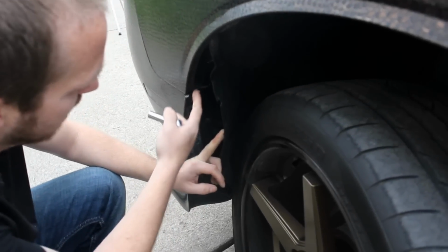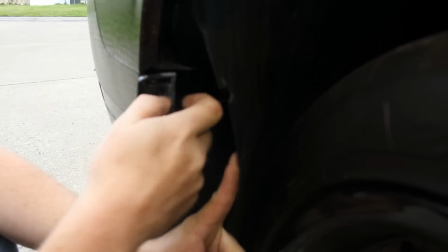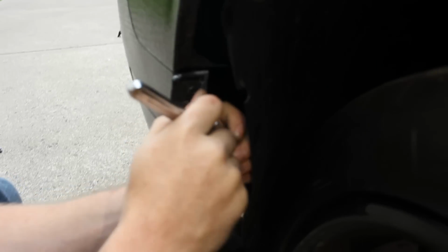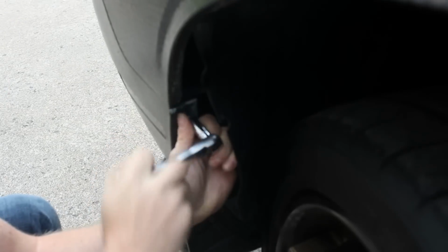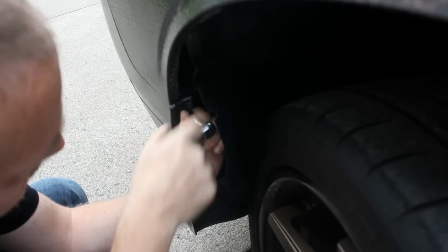Alright, so before we start on that back bolt, let's focus on these. Removing this bolt right here will allow you to pop the bumper cover right out and away from the body. And that little bolt all the way up there will help it release from the front end. So we're going to start with this one, and this is usually a really easy one. It's just that these plastics are a little rough on the edges, so if you prefer to wear gloves, you can. I find gloves cumbersome sometimes, but there will be one of these on each side of the car here.